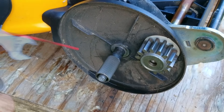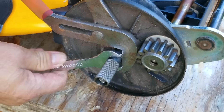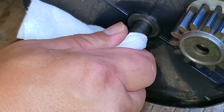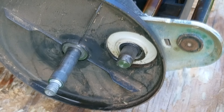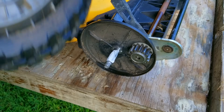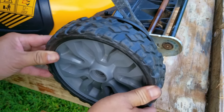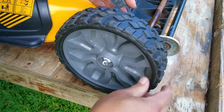As the insert gets further out on the axle I have to increase the number of wrenches — it's starting to look a bit comical, but this is a lot better than using locking pliers and breaking the insert. The worst part is it doesn't appear to be rust holding the insert to the axle, only old grease. Next I'll clean both the inside of the insert and the axle with brake cleaner. To prevent this, clean and lubricate the axles at least once a year. After that I'll put the insert back and apply a generous amount of lubricant to both the axle and insert.